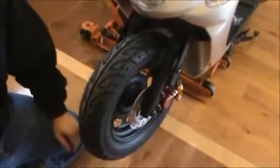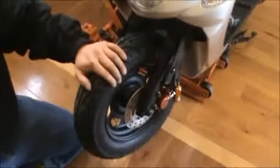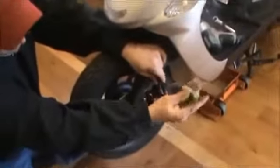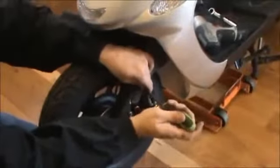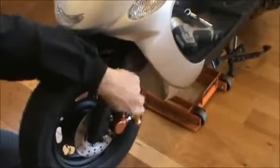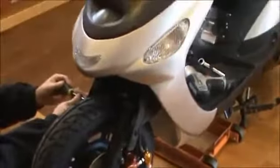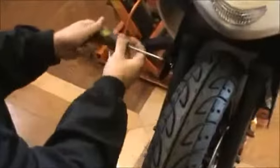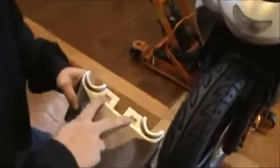So the front wheel's on. Our next step is putting our front fender on. You'll notice it's got these two screws in there — you actually need to take these two little screws out on the sides. They're going to be similar to our front cowl; they're going to have little rubber bushings on them. Grab your front fender. You'll notice it's got two little slots in the front, and underneath there are two little metal slots, one here and one here.